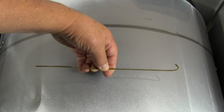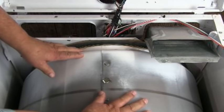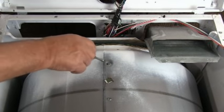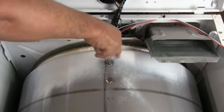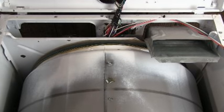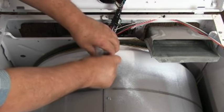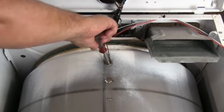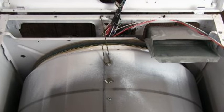Get a piece of a wire coat hanger about 11 inches long and bend the end like this. Turn the drum around until this hole aligns with these screws. Loosen the screw about halfway out. Hook the coat hanger wire to this hole, then bend it around the screw like this. Then tighten the screw so it holds the wire in place. I will show you in a little while why you should use the coat hanger like that.